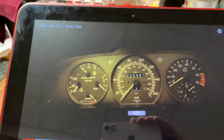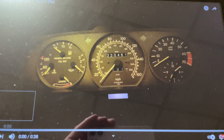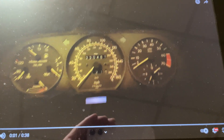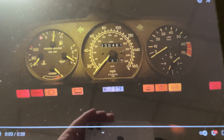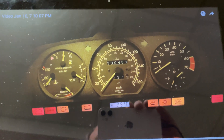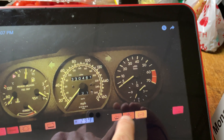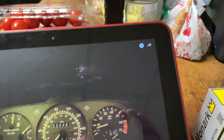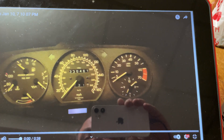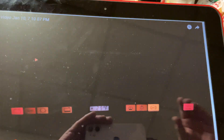We have full power, but this thing started to flicker because the brushes are not long enough anymore. I don't know how many more miles it has left, but pretty soon the alternator light starts to flicker. Some people have reported the ASR light coming on with the ABS light — either one of the two — and that's usually where they are with these things.